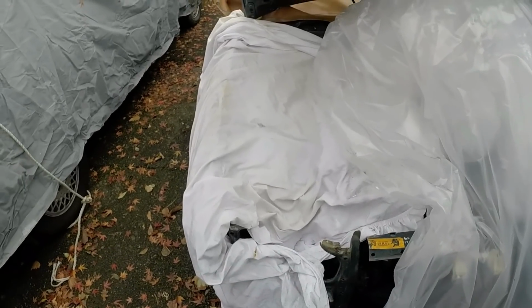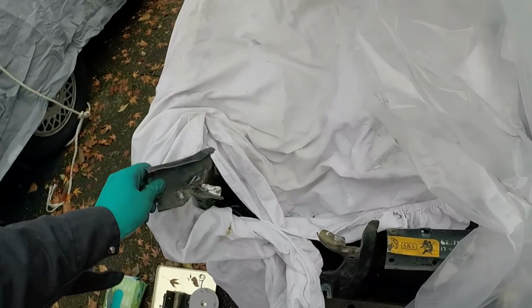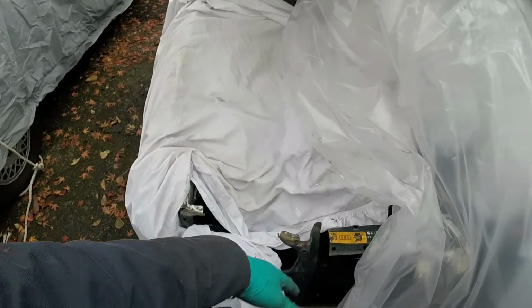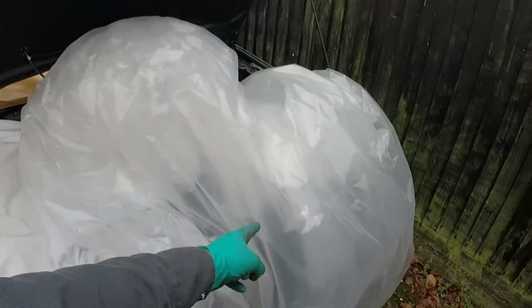So yeah, it just means that now I can dance over that with a grinding wheel or sanding wheel or something, and have nice surfaces to go back hold onto without having to spend ages very carefully filling in holes with the MIG welder. Every time you do that, it hangs off the bottom, and you end up with a horrible shape under there, and it's just another rust spot. So I'd much rather just never break that top surface. Right, that's all done. Same again there.